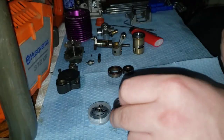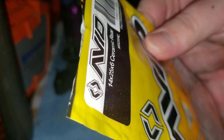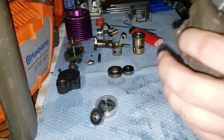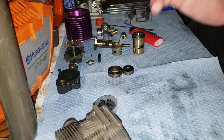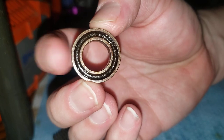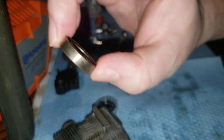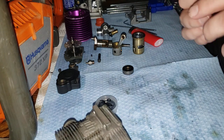607-2RS for the front, and a 14 by 25 by 6 for the rear. Because people kept asking: if you have an all-steel cage bearing — so it doesn't have that plastic ring like this one — it doesn't matter what way you put it in. Pop both seals out and put it in either way. It doesn't matter. You can do it for the front or the rear.